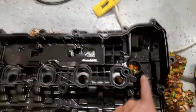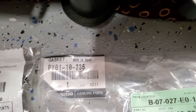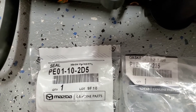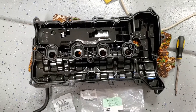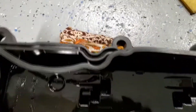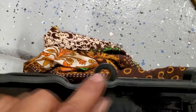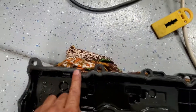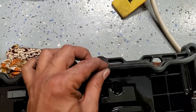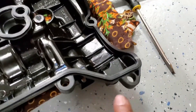We are going to reinstall the new rubber gasket and install it on the cover itself. The part number for the valve cover gasket is PY0110235. The part number for the rubber grommet that fits into this hole right here is PE0110 2D5. One thing to point out while installing the gasket: this is pre-formed so the shapes match. When you get to the corners, make sure you put the corner in. When you get to the curve, pull it and have it installed in the area where it needs to be. All of these things fit in perfectly — just make sure you grab the gasket portion that is meant to be where it is supposed to be. Everything is formed so it is very easy to install and place correctly.